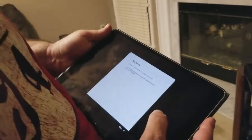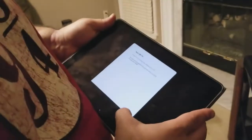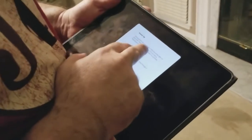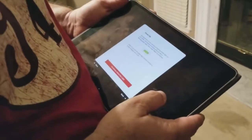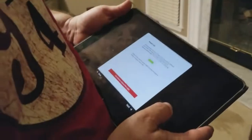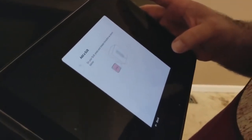Your TV is currently on — if your TV is on, turn it off, which it is off. You will now be guided through the setup process for your play bar. Do you have a subwoofer? Yes — add a sub. Ensure your sub is connected, which it is. During power up you'll see a flashing white light on the sub — wait about a minute until you see a flashing green light, then press next. The green flashing light is right down there on the side of the sub. On your sub, press and release the button as shown — there's a button on the side.